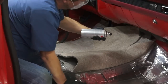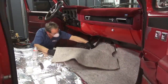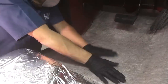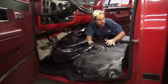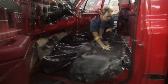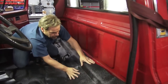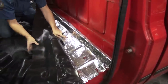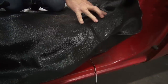You can just work your way down the rest of the way. This starts working from the back, working your way forward, smoothing it down, getting the rises in place, and then you start trimming. These little recesses and pockets will give you a clue as to whether or not your mat is in the right place. We've got a recess here that's molded in, and it shows us that there's a seat belt anchor right here — pocket, anchor hole — we're in the right spot. So start smoothing it out.